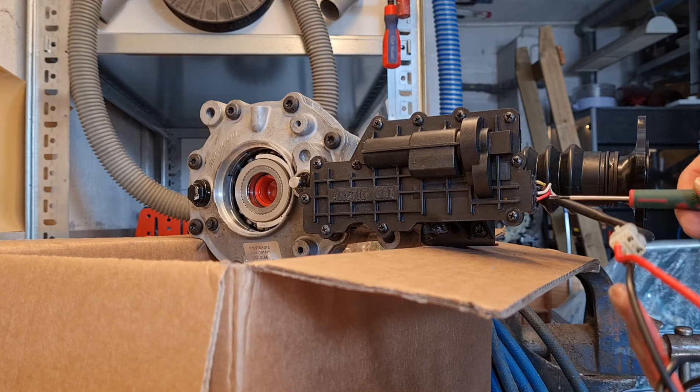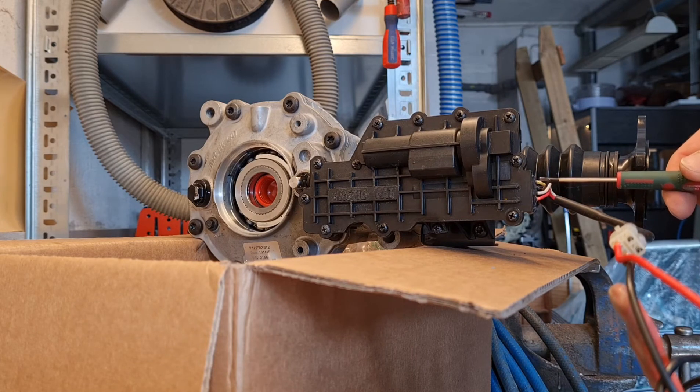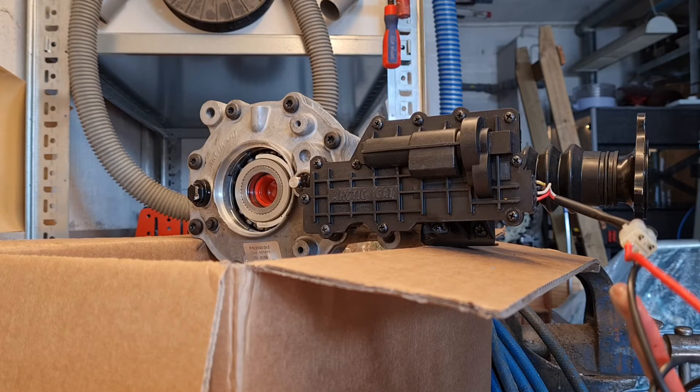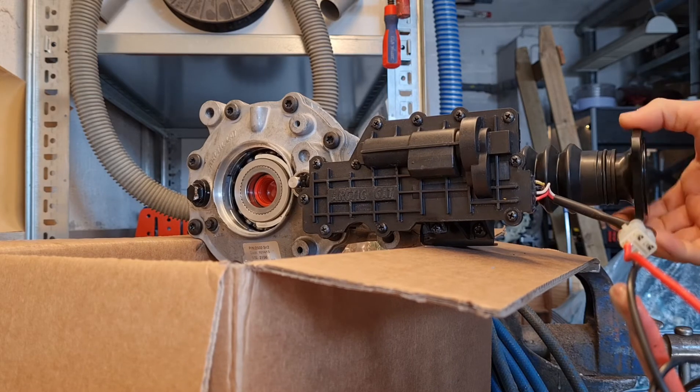I still want to be able to engage the solid diff. I have a red, white, black, and yellow striped cable. The red and black are normal plus 12 volts and ground, and the diff is engaged by grounding the white and yellow cables — so grounding becomes the signaling. To engage, I need to ground the white cable first, which will engage the diff.